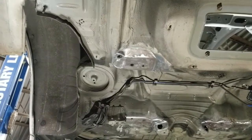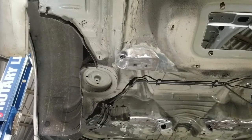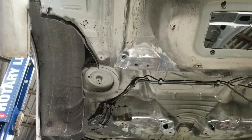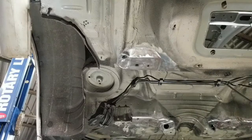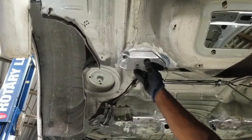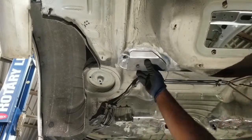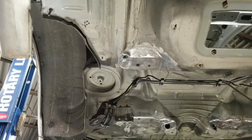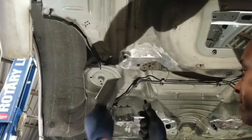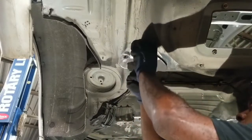Now that this one's all prepped and ready to go, we're going to show you an easy way to put the plates in place. We use AKG Motorsports plates because they're much thicker than everybody else's — it's a much stronger piece. Not saying other companies are inferior; they make pretty good stuff, but we just find these work better in our application. Basically the plate falls in place just like this. You're going to weld it, stitch it all the way around, bend it to close the gap, and weld it all up. One way we hold it in place to prep it for welding is to take a simple BMW lug bolt.